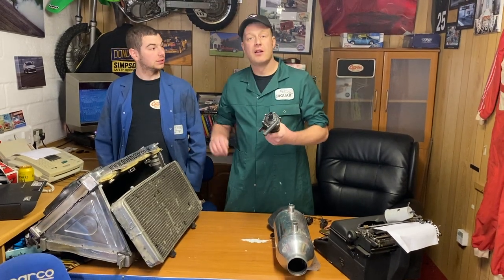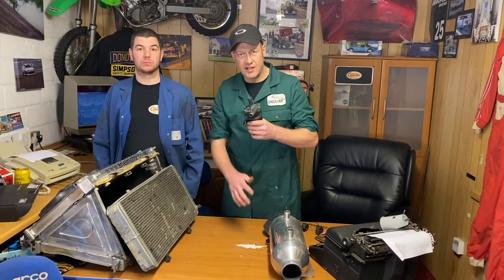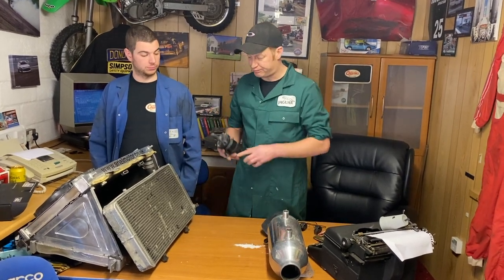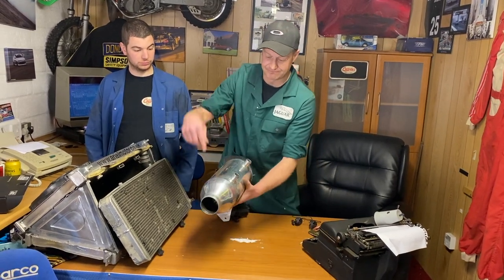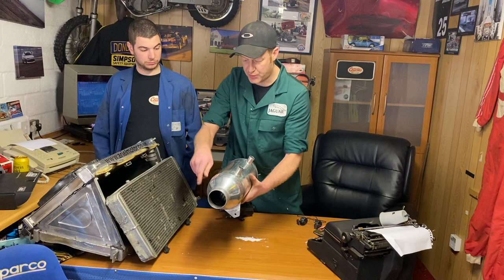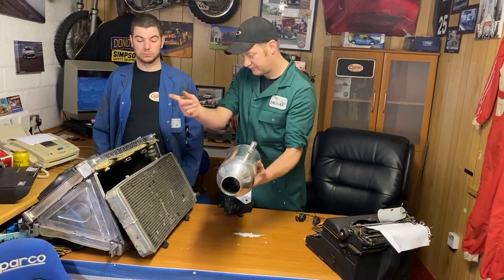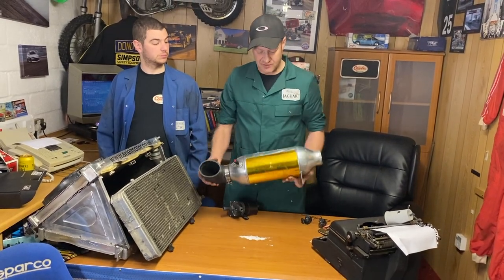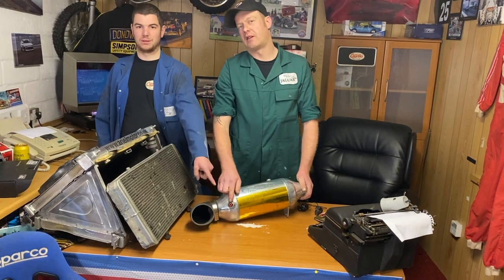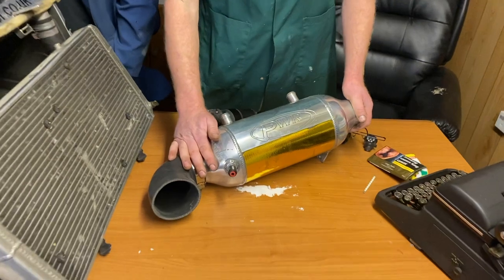Basically, fire the motor up, pump on, closed loop, independent water system on its own, through the radiator, out the radiator, in the charge cooler. Magic. Cools the core inside, back out, through the pump, back through the rad. Lovely. You'll probably see on this one as well, we got a little squirter in there. Quite big, we drilled it out. This is the throttle body side.